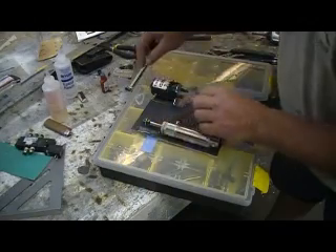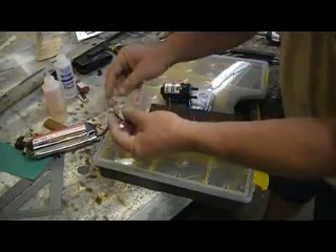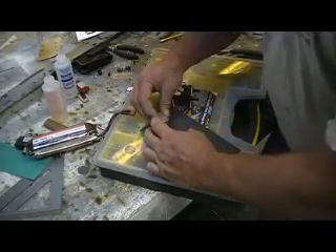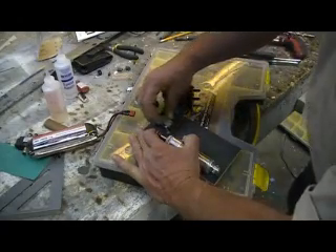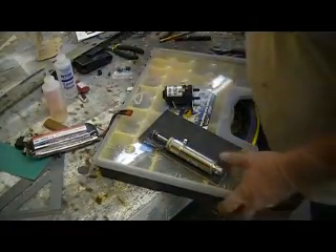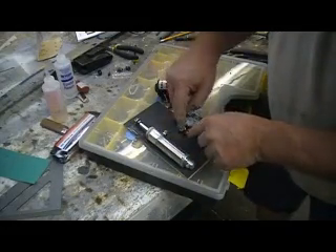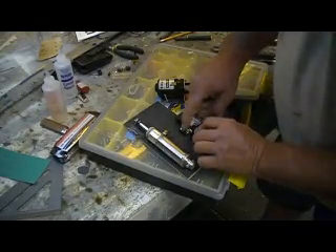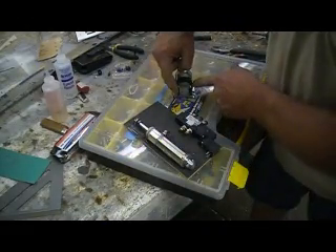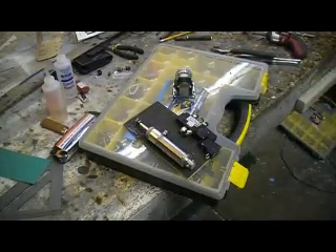That's what will turn this pump off. I'll just splice the wires going off my battery - instead of going two wires to the pump, I'll take one wire to one side and one wire to the other side, on/off. Real simple. When this pump is filling up and hits that switch, it'll stop pumping. Then when I open the door it'll start again. This valve goes in here, this one goes to the front, this one goes to the back, these two go to my reservoir as returns. This is the fill, and it'll just cycle the system - one side of the pump goes to the tank, one side goes right to the front and back. Bam, that simple.